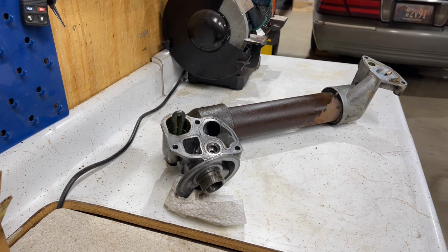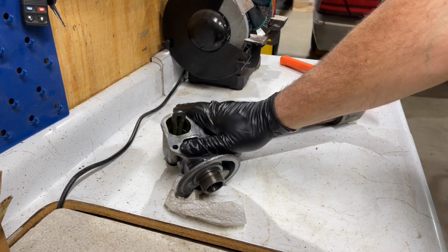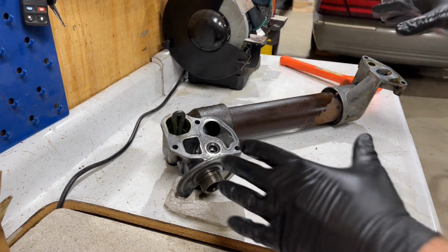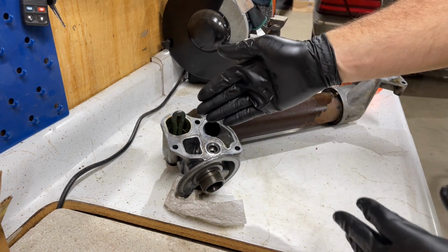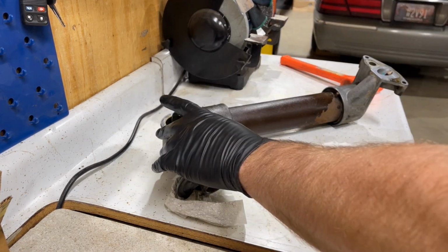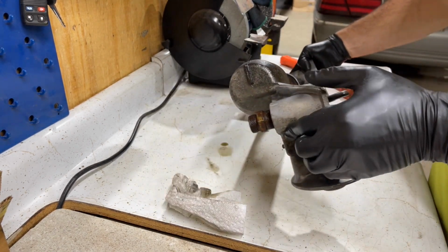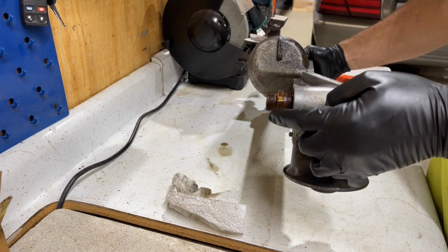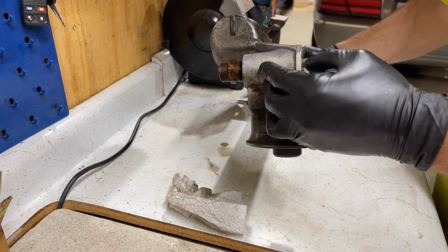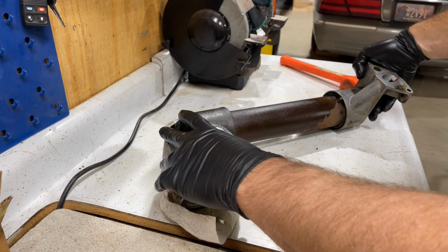So here's your oil cooler. This is the timing cover side. This is obviously the back side that goes to the block. This is your block heater. If you have this out, this is a great opportunity to change this block heater. They do go bad. We replaced this one on this truck not too long ago, which can be quite fun because when you take this out, which is your block heater, that is a direct passage to coolant, and that's a very large hole, and it will come out very quickly. So you have to be quick if you're changing these in the truck.